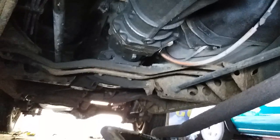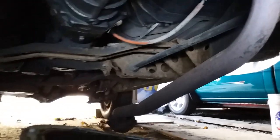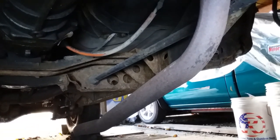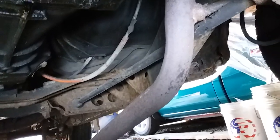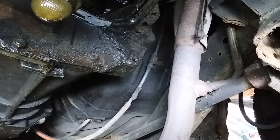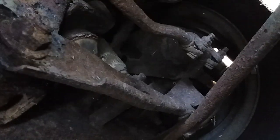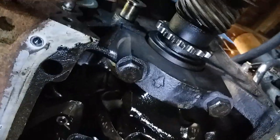I was looking over the truck itself as well and it doesn't really look like it's in terrible shape. The frame has got surface rust on it, we've got grass hanging down off the rear end — that's from flogging the hell out of it in the field; there's a video of that on my Instagram page. We do have a rear main leak — that's going to be next. After I'm done with the timing chain and head gasket work, I'll take the transmission down, put a new clutch in it, resurface the flywheel, and it should be good for a while. All this stuff is already on the red truck and in good shape, so I'm just going to take the red truck apart next year and transfer all the good two-wheel-drive bits to this thing.